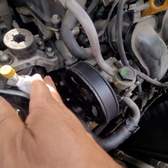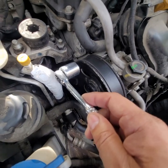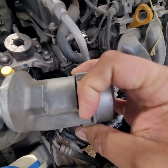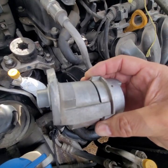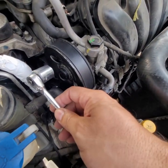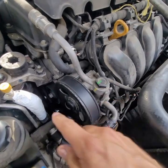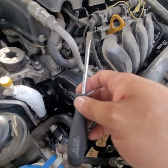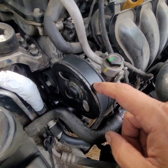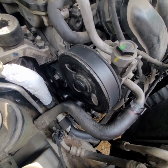Finally got it on. I had to put the 17 millimeter in there — it barely fits between the wall, but I got it in. I moved it all the way from here to here, roughly 45 degrees of angle, which meant starting way down and moving it all the way up. It took two people — one holding it over here while at the end I used a trusty screwdriver to get it all the way around. This tensioner is really tight and the belt is brand new, so it took a while. Let's start her up and see how she sounds.